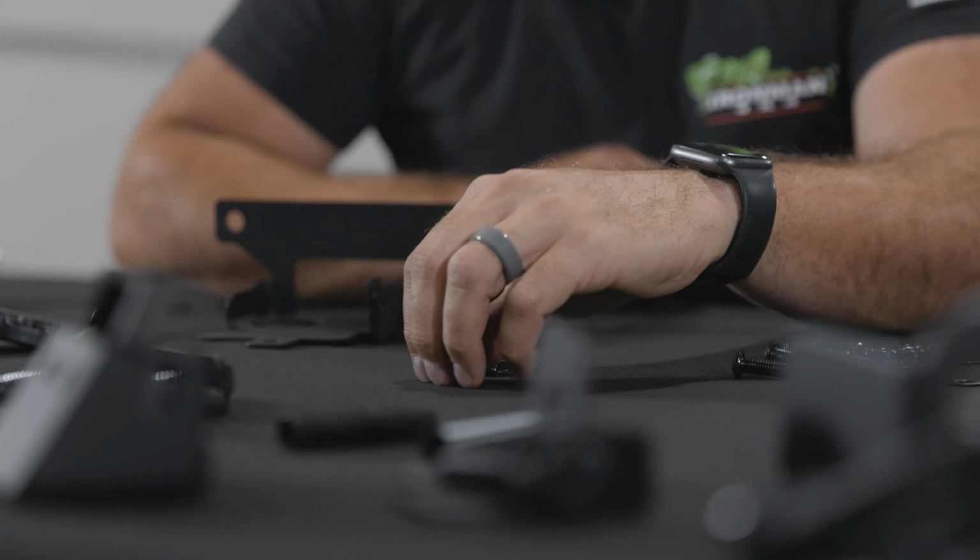Now let's tighten down those guys. I have got a 10mm socket, and this Allen is a number 4. So we'll keep that tight there, and we'll start tightening these guys down. Now I'm going to tighten up the adjustment slot. Okay, I'm going to leave things snug, but still loose. So after we get this installed, then we can lock it down when we get the positioning correct.